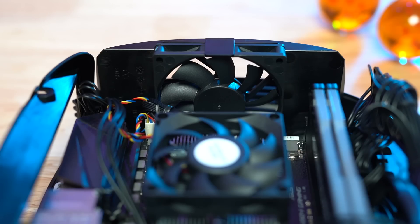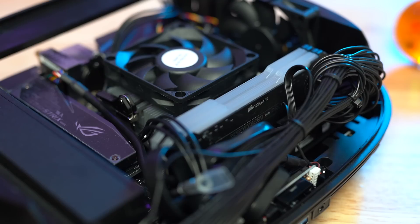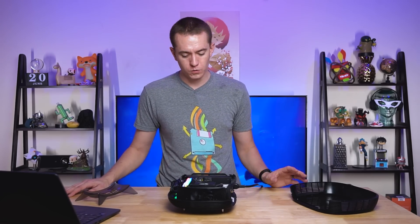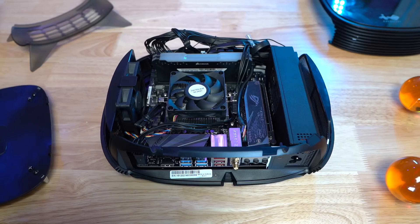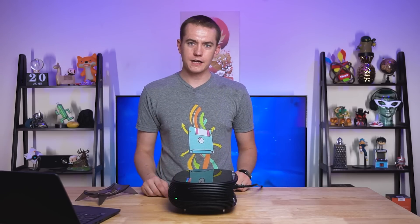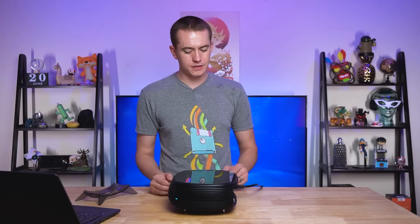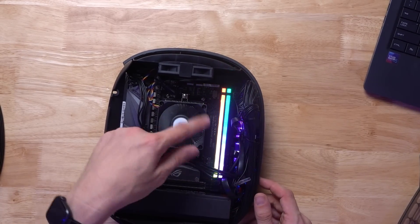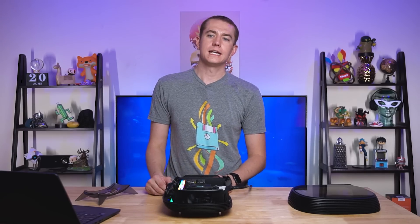This thing can fit basically everything. It can fit high-rise RAM — you can see I'm using the Corsair Vengeance RGB Pro. The only caveat I found was that it cannot fit normal AMD Wraith coolers. I actually ended up losing my Wraith Stealth that I had with my APU; I was trying to fit a regular Wraith cooler in here and unfortunately there's just not enough clearance — it's like a couple millimeters too small. A little bit more plastic would have made it so I wouldn't have had to compromise on that. But a Wraith Stealth or one of these coolers that came included with my Athlon 3000G, or a number of low form factor coolers, is possible.